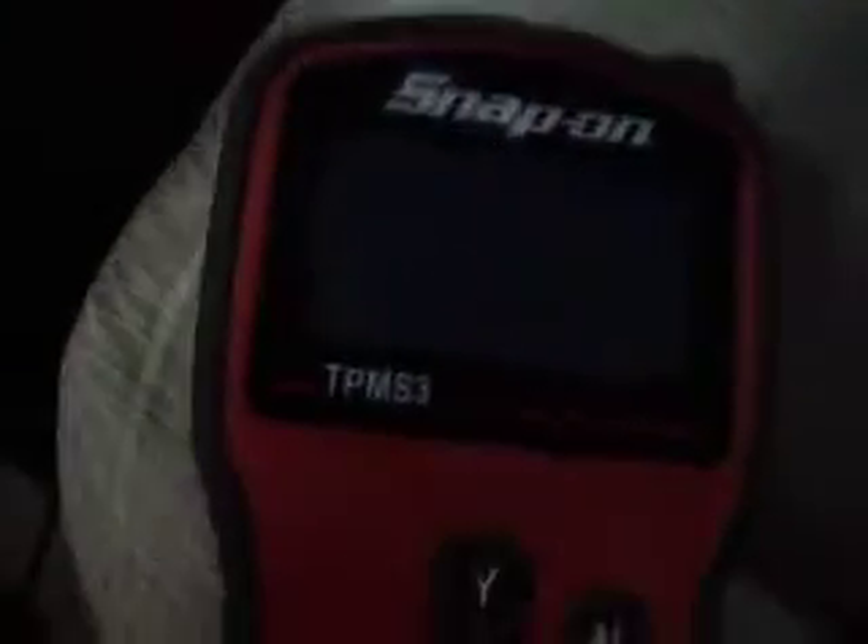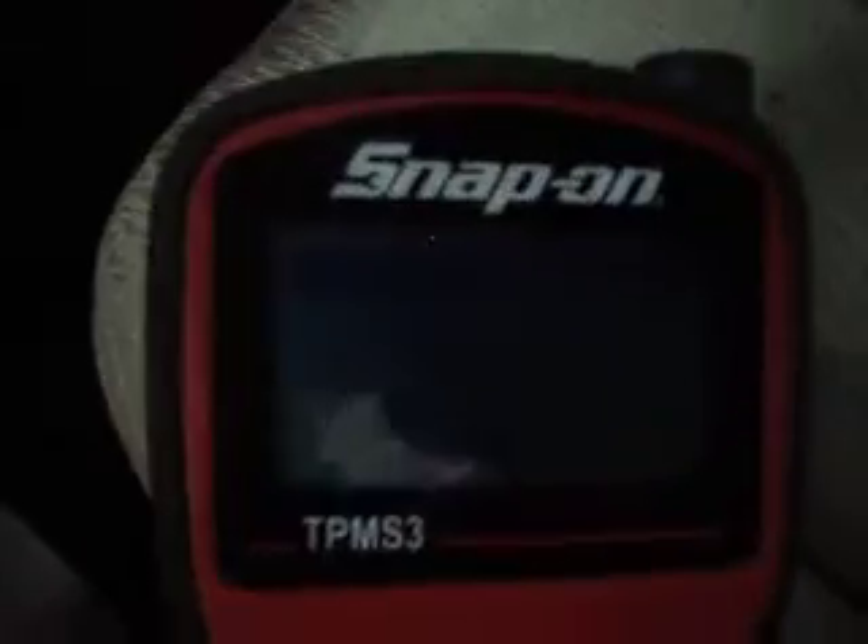And that's all you have to do. Now, if you had put a new tire pressure sensor in one of the tires, even if you just change one sensor, you should read them all. This will store the information. If you want to go back and review the information, you can still do that — plug it into the car, follow the prompts on the screen. It's a lot faster than entering the numbers through your scanner.